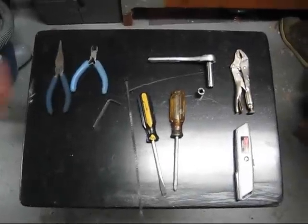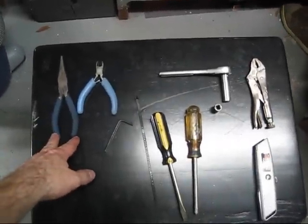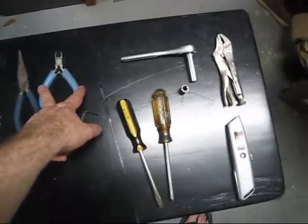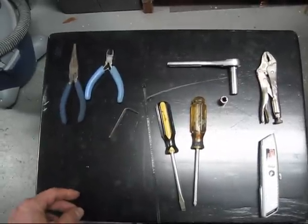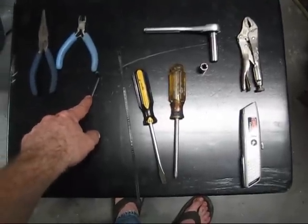Here's a quick preview of all the tools we're going to use today. We've got needle nose pliers — that's just to help with the hose clamps. Wire cutters — there are a couple of places where the wire is tied to the motor or to mounts that we're going to remove. We've also got a four millimeter hex key — that's to put the filter bracket on.